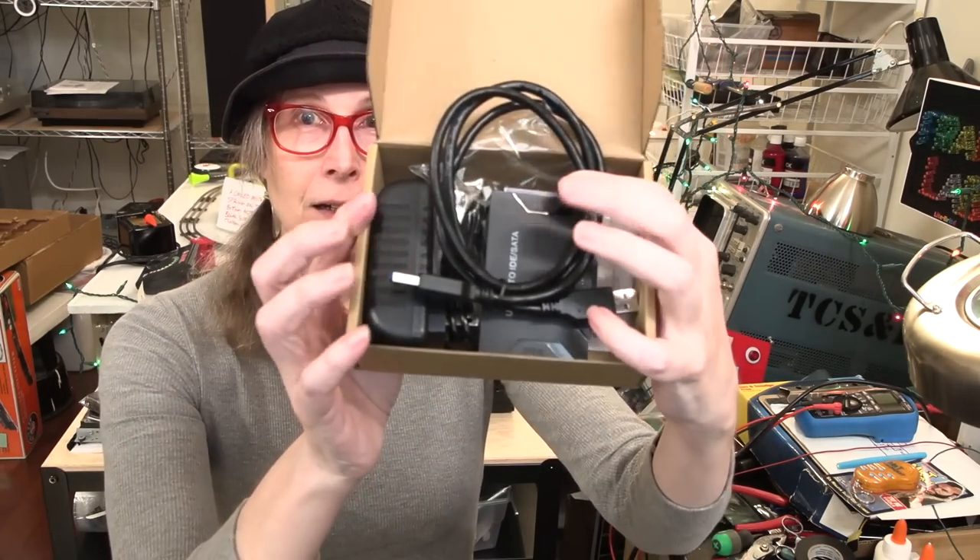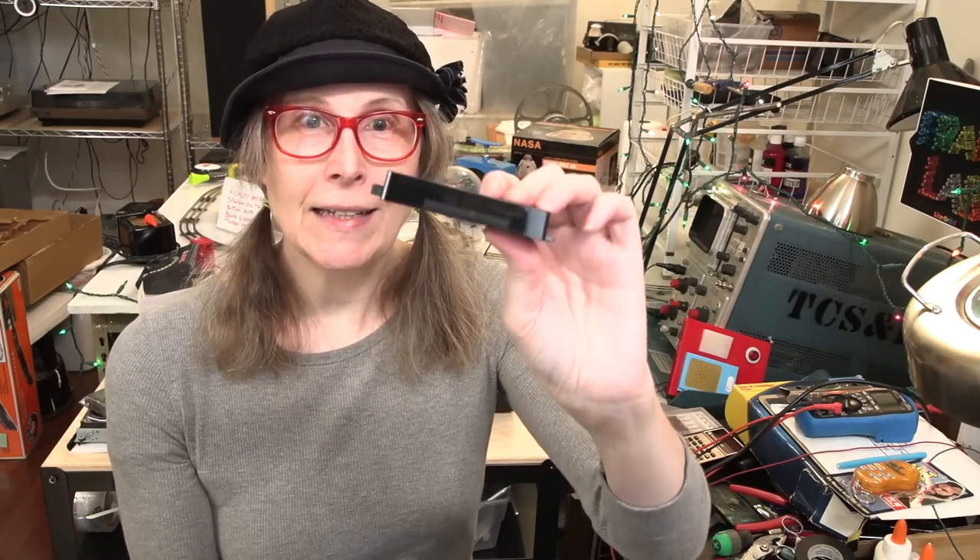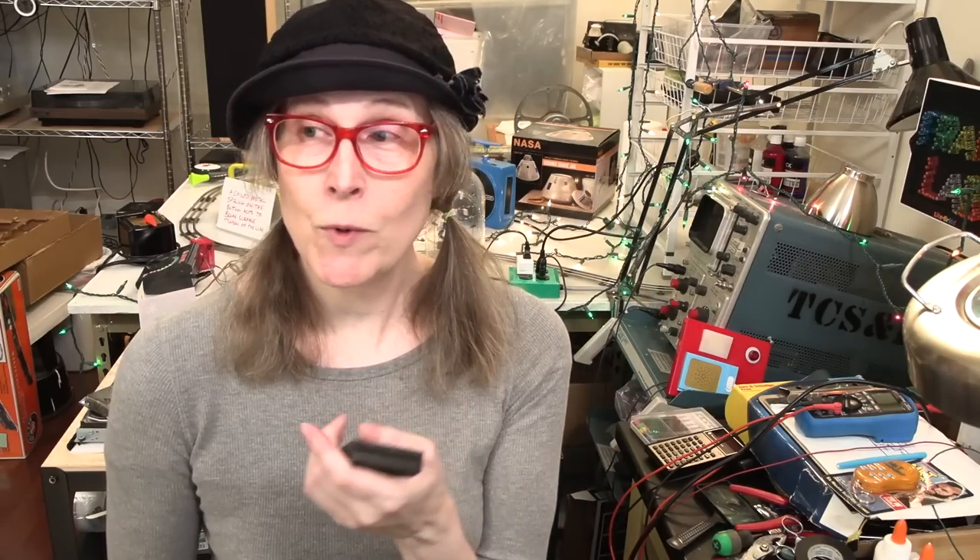In the meantime, I did get a universal docking station for hard drives — a USB 3.0 2 SATA and IDE. A lot of people were talking about this Tascam recorder and the hard drives. The Tascam design records the digital stream directly to the hard drive, rather than incorporating it into a file like you would on a PC or Mac, so if you look at the hard drive, you really don't find WAV files. It's really the only way to extract WAV files from the Tascam is through its onboard micro system via USB — if you just try to offload it directly from the hard drive, there's really nothing there. It's just raw data in the sectors.